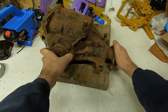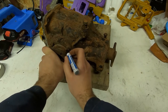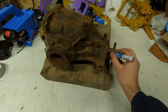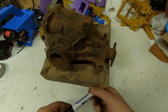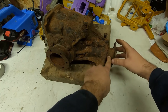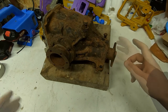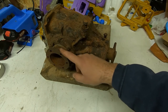You can do so by using a permanent marker. You just have to mark it around here so you have the alignment checked correctly. Another marking would be made here on the input shaft, like this. You check it here and here. You will be turning this input shaft — it will be spinning. Simply, the final drive ratio is the number of times that this input shaft spins while the output shaft makes one full revolution.